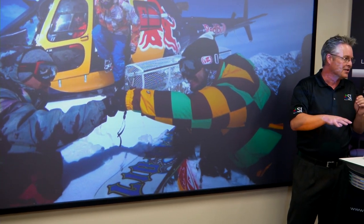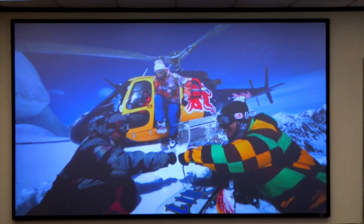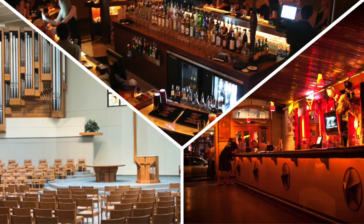Our state-of-the-art sales team at Screen Innovations is going to help you pick that out. What we're showing today is a very affordable combination with Black Diamond technology — this is our 1.4 gain Black Diamond screen technology. Right now we've got 28 ambient foot candles in here — 28 foot candles of light. This is a very bright room, nothing but fluorescence above us; there are about 12 fluorescent lights right above the image. So with your projector and the Black Diamond Venue, this is going to open up a lot of opportunities: house of worship, nightclubs, bars, hospitality — anywhere we're combating ambient light where we can't get rid of it. We need a really bright projector but don't want to spend tons of money. It's a very affordable solution with the E-Vision 8000 — it can take different forms depending on the color wheel you put in it. Combined with the Black Diamond, it's a winning combination.